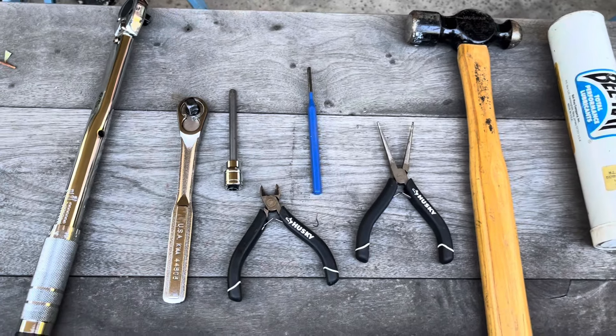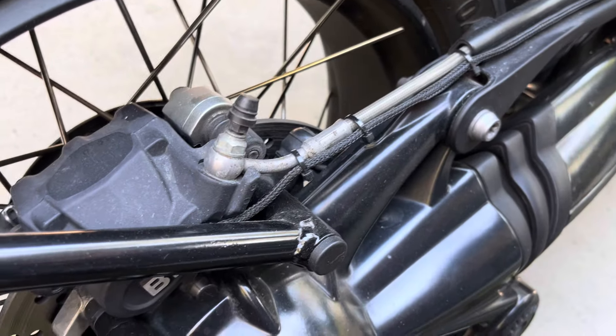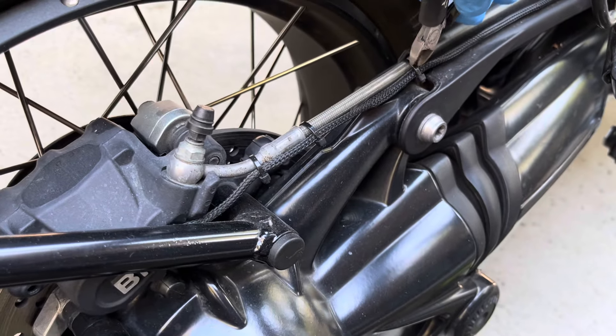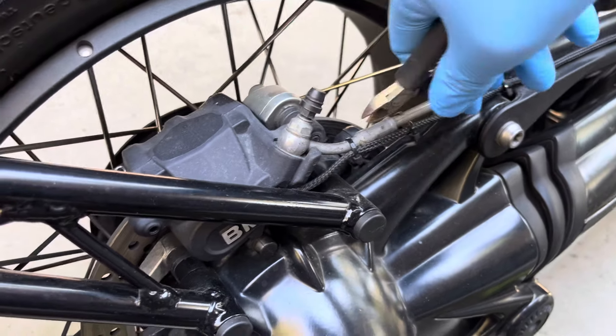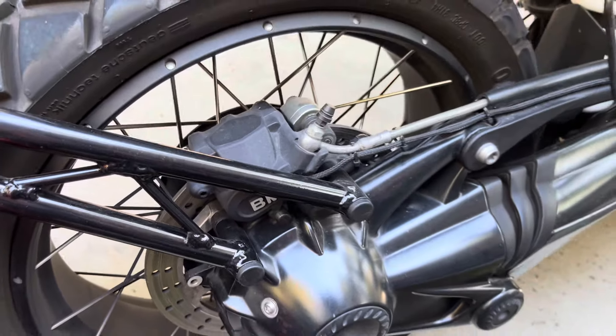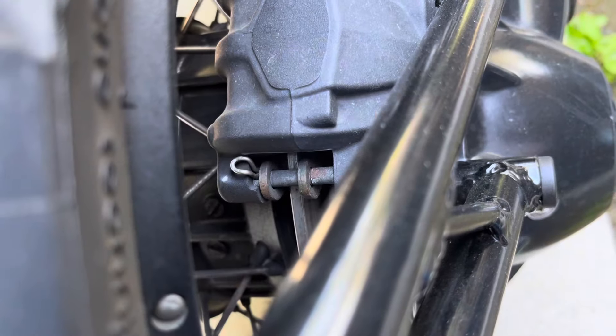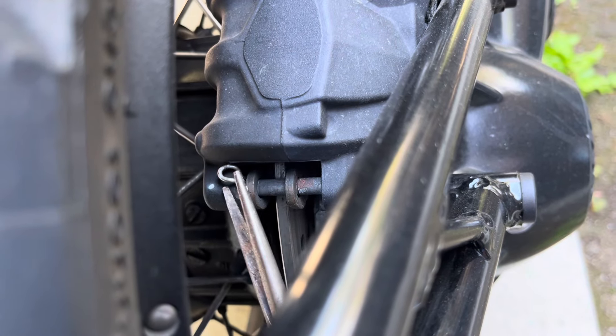And torque wrench. My setup is just a little different from stock. I'm using this license plate bracket that uses the threads for the stock Torx bolts, but the rest of the procedure should be the same. You won't need a bike stand for this, or need to remove the wheel, just your bike's side stand. Start by removing the R-clip from the pad pin.